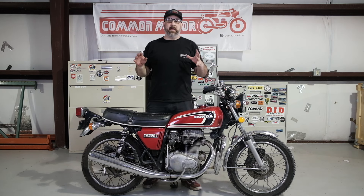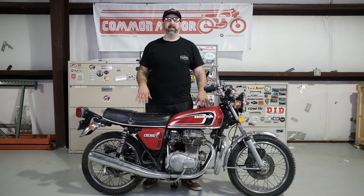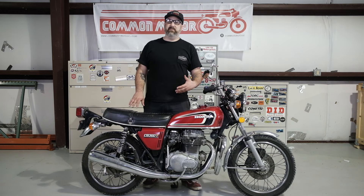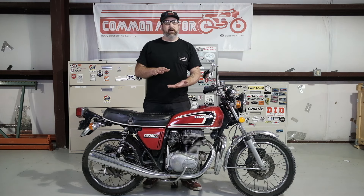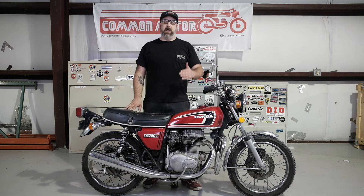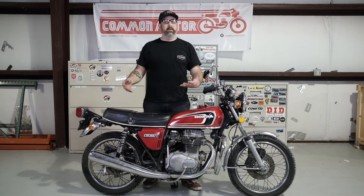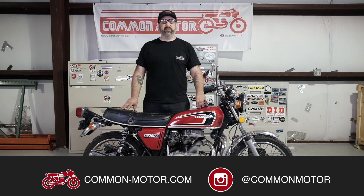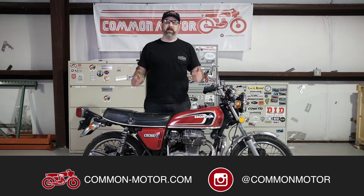I hope that sheds a little more light on how to adjust your rear shocks for your bike, your rider weight, the bike's weight, and any particular loads you might have — a passenger, saddle bags, etc. — and also for how you ride. The rule of thumb again is about twenty to thirty percent of the shock's travel needs to be compressed when you're sitting on the bike. It's not exact but that's what we're shooting for. It's also good to have a friend help you so you can see what's going on when you make the adjustments. A shout out to Jeff at Icon for enlightening us on shock adjustment. Again this is Brendan with Common Motor, common-motor.com. Thanks for watching. Make sure you follow us on Facebook and Instagram, subscribe to our newsletter via the website, and subscribe to us here on our YouTube channel. We will see you next time. Bye.